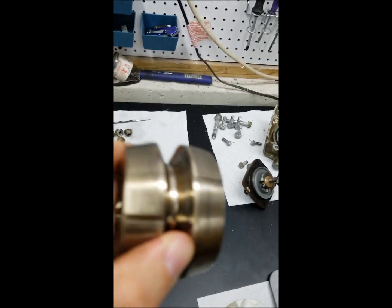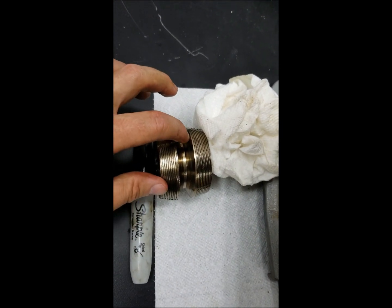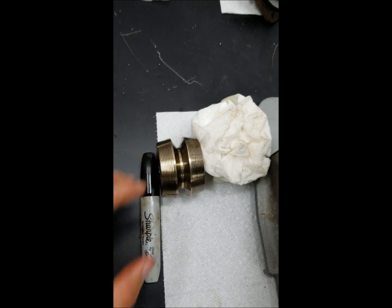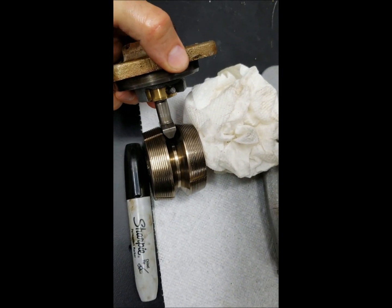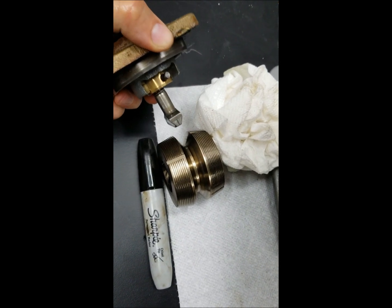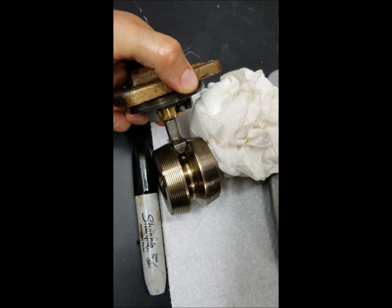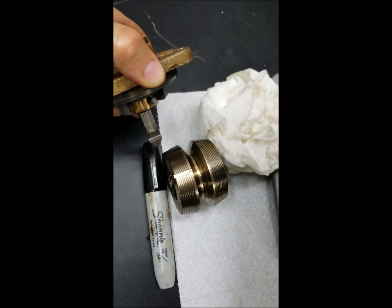And then I guess there could be some dishing in here as well, which would affect the shift shoe and how much it engages. You can see that shift shoe rides right in there and pushes it up or down, but it's always rubbing against that beveled surface. And you can kind of visualize how if you push this in that way more, you can get a little more distance one way or the other.